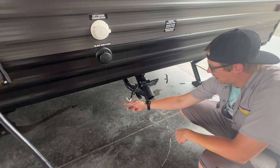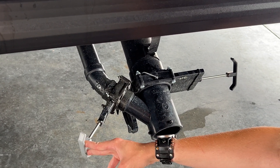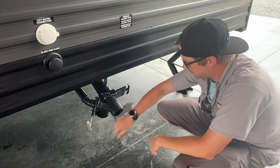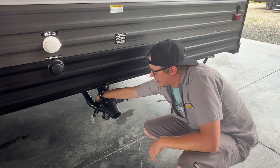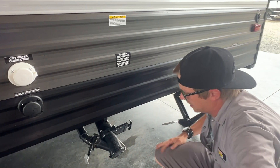The gray valve on the other side of the black tank valve is your gray tank valve. This is what's going to open up the lines and empty out your kitchen sink, your shower, and your bathroom sink. The black tank is for your toilet only. When you're in travel, you can leave them closed, and there is a cap that will fit over the port — it locks onto those knobs, give it a twist, and it locks into place.